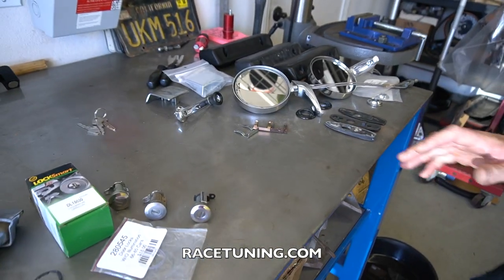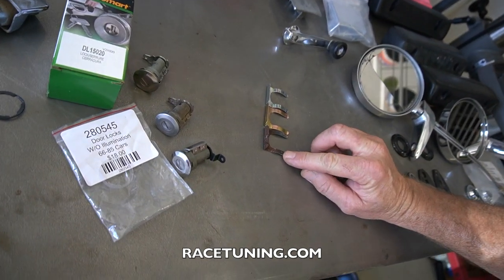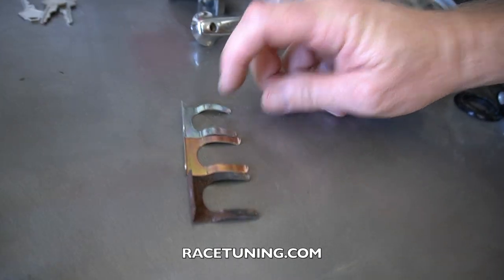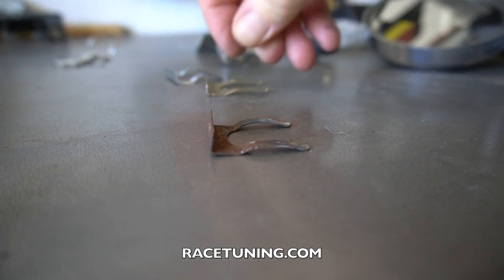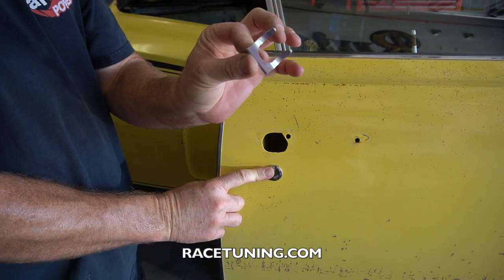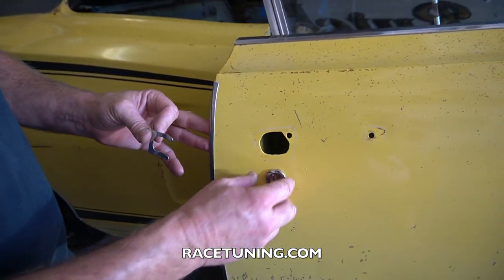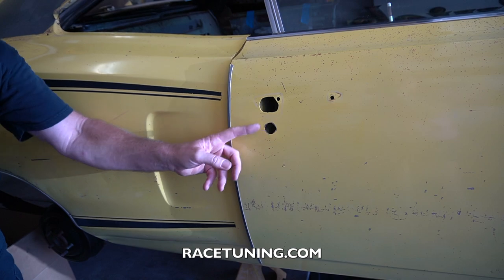This is actually very important. We have three different clips that came with these door locks. Here's the original rusty one — pretty decent quality. This one came with one of the kits — you can see the extra curvature on it and there's no springiness to it at all; you can't push it down. The original one you can. If you install the stiff aftermarket clip and force it, you're actually going to bend your door. I made that mistake on my old 69 Roadrunner — I used the aftermarket clip and forced it, and if you look down the side of the car it's basically like a ding now. Use the original one, or that decent-looking one.